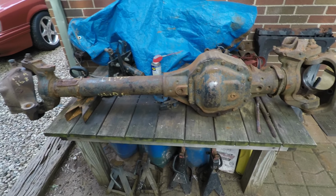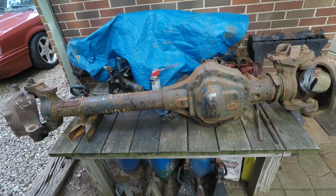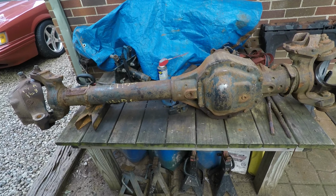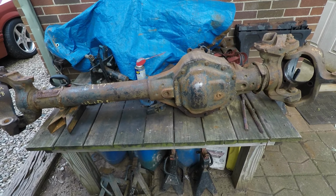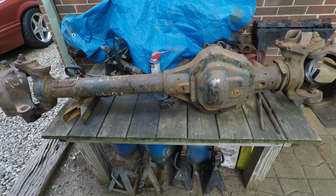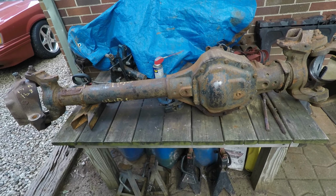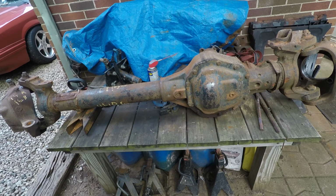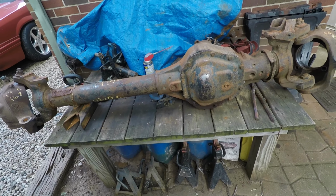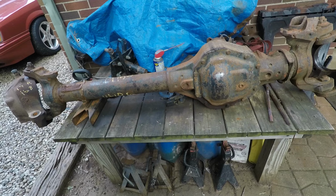And I think I'm going to put in the Spicer 10-inch gear that they make for the Dana 60. It comes out of the Dana Super 60, but it does fit this. I do have to go with a 4 Series carrier, which is fine because I need to put a carrier in anyway. But I'm not sure that really gains me anything going to a 10-inch gear, but I mean, it couldn't hurt, right? I know it's a little more rotational mass, but it's definitely a stronger gear. But it is what it is. The cost is pretty much the same as a 538, 9.5 or 9 3/4, whatever a Dana 60 is OD.